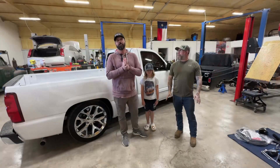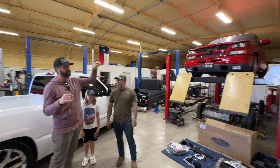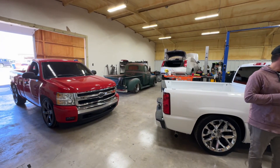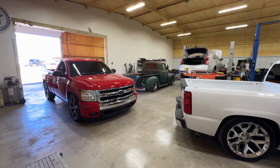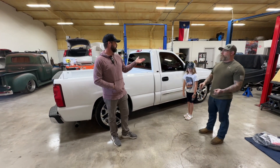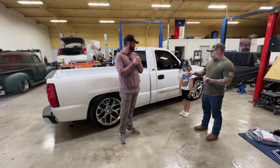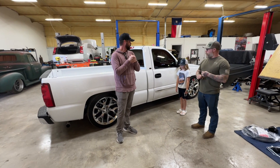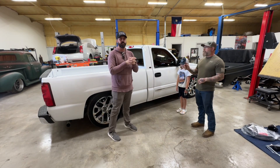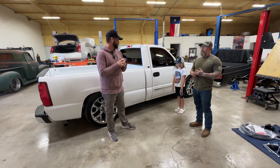Alright guys, we're headed to Mr. G's here in Liberty Hill. There are absolutely tons of trucks in — Jason's truck is up on the rack, Dan's doing some custom exhaust and stuff. We've got our truck here, and Pat, what are we doing? We're doing a full front RideTech kit with coilovers. The rears aren't even notched and lowered, so we're going to do a set of adjustable RideTech rear shocks. We're doing a set of 16-inch Little Shop brakes all the way around in a custom color, and putting on a set of BC Forged 20-inch wheels.